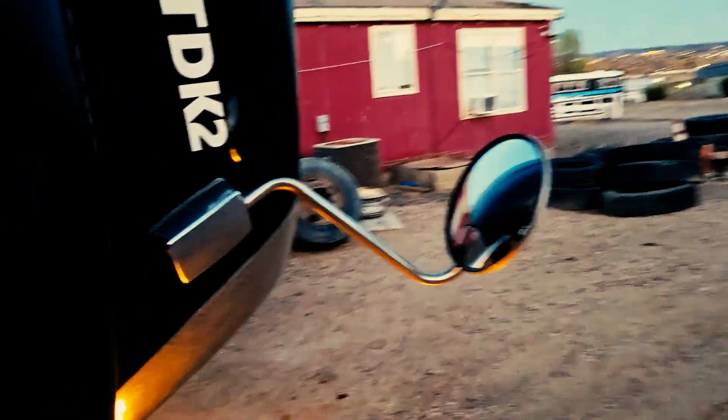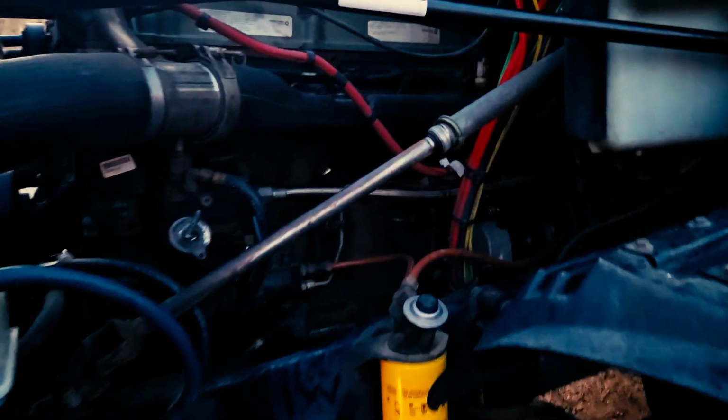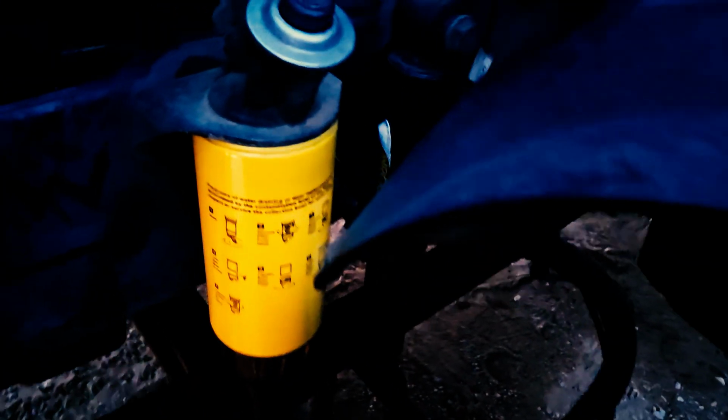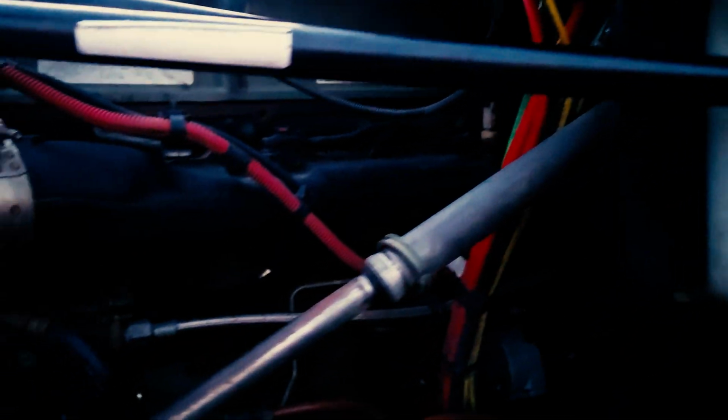Now you will go to the driver's side engine compartment and begin your driver's side inspection. Again, you're going to start off with all your hoses and wires. So I'm going to inspect all my hoses that I can visibly see and touch, starting with my air brake line, to ensure that they're properly mounted and secured at both ends. There's no abrasions, bulges, nor cuts. There's no leaks of any kind. I'm going to inspect my ABS line, all my electrical lines that I can visibly see and touch, to ensure that they're all properly mounted and secured at both ends, and that there's no cuts, tears, no frays.